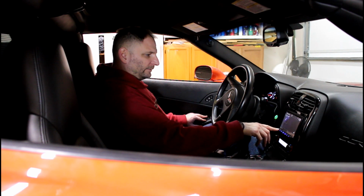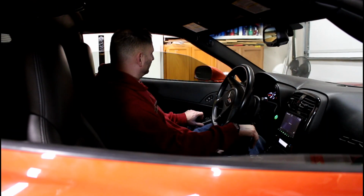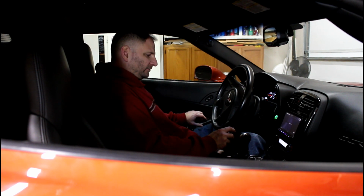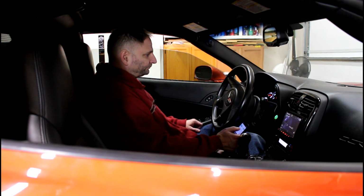Before we start, let me say this. Check the windows. We'll do the right side, pull it all the way up. Once it closes all the way, release, count to 3, then pull up again. 1, 2, 3, 4, 5. That should be re-indexed. We'll put the left window all the way up. Once it's all the way up, release, count to 3. 1, 2, 3. We'll pull up 1, 2. We'll grab and pull up on the window switch, count to 5, which we've already done. Release, and now we'll push down.